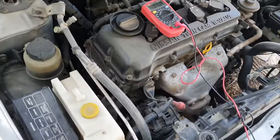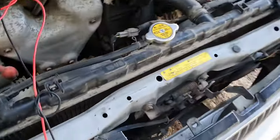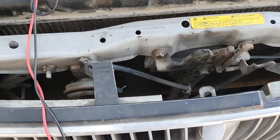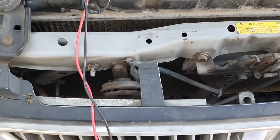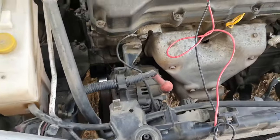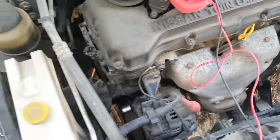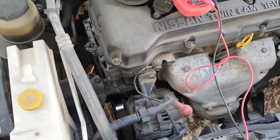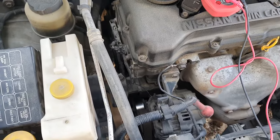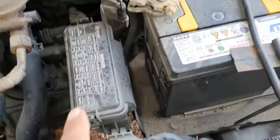It's my friend's Nissan car. Yesterday night he called me that the horn keeps honking and does not stop. He was not pressing the horn button, but it kept running, and he was very frustrated. In this utter frustration, he called me saying, "I am on the highway and my horn keeps honking, what to do?" I advised him to pull out the horn fuse if possible.